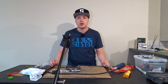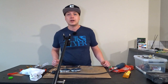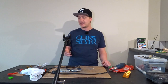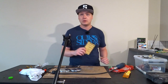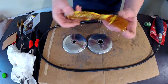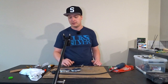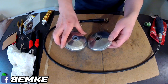Now here is the method to get your dishes — or variator, whatever you want to call it — to look like this. It was a trial and error since I've never done this before. First, use a Dremel tool with a sanding pad to get all the rust cleanly off. After that you get a scuffed surface. Then take your sandpaper, put it in water, and wet sand the whole surface of the pulley. After that get some polishing compound, rub it all over the disc, wait a few seconds, and then hit it with a polishing wheel. I used a Dremel because I don't have a big polishing machine, but it still works — it's more work but you get a result like this, and I am pretty happy about it.